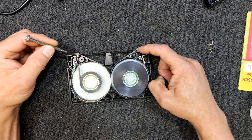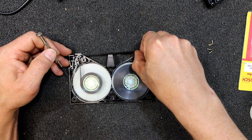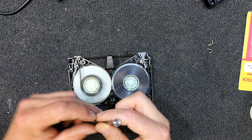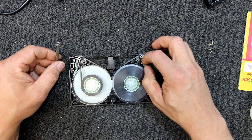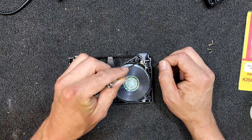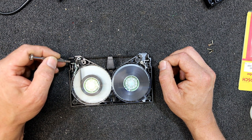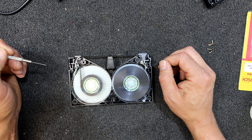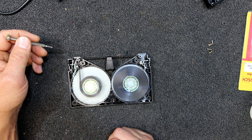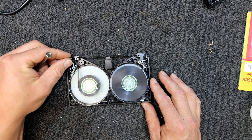There are a couple of little posts here — these will actually fall out if you're not careful. On VHS they come out. There's a couple of other little posts — the fixed ones and the little roller ones that lifts out. It's got these little wiper things which I think are to brush any dust off the tape before it comes back inside the cassette case, and probably prevents any dirt coming out of the case onto the heads. There are also a couple of little brake levers here.